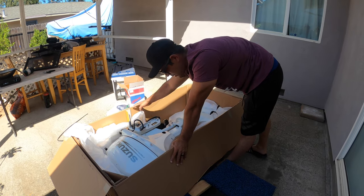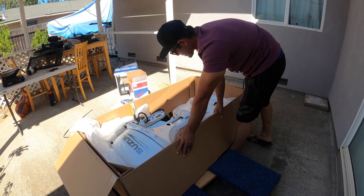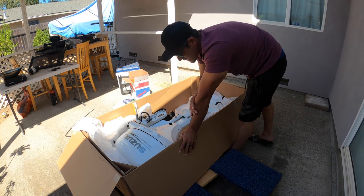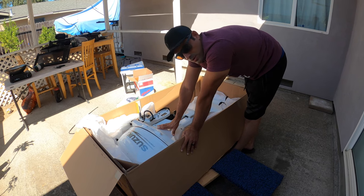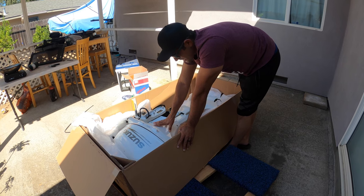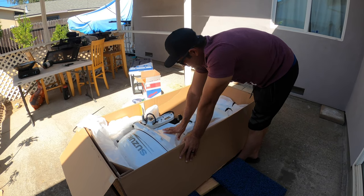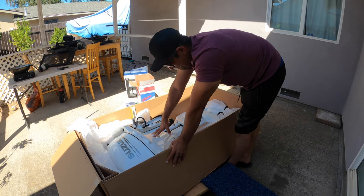All right, we're gonna continue unboxing this, get it propped up. Just remember, always remember, if you're gonna start it, you gotta add oil. So make sure you add oil, check your owner's manual to see what kind this is. This one takes, I think, 10W40. You can either go Suzuki or anything that's, I think, NMMA certified, something like that. But yeah, so 10W40 for this guy. We'll get some oil and then hopefully line it up on the Arima and get it started for the first time. All right.